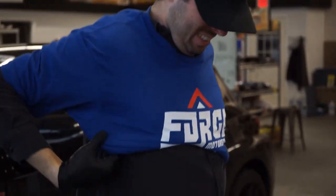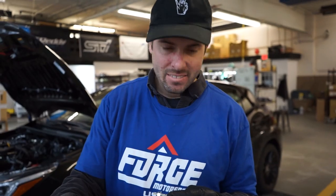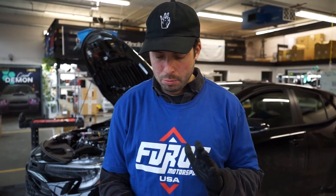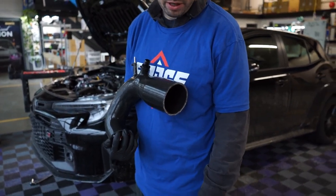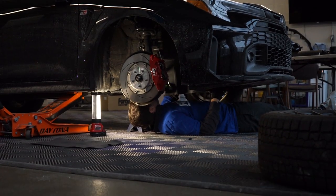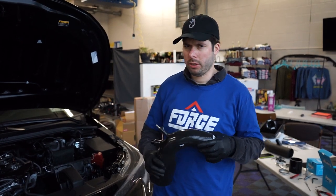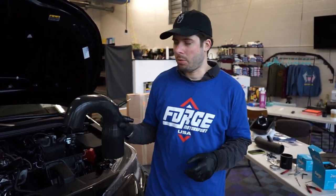We are back. I slept in the shirt, it is very comfortable. I got the turbo stud out - the stud for the inducer side of the turbo. Got the tool for that last night, came out like a dream. We did pick up the correct hardware - I did have to shave the ends down a little bit just to make sure we didn't poke into the turbo. To recap: we are going to put this on the turbo inducer, that is going to go to our silicone inlet opening, this will come up to this hard pipe which mounts to the engine, and then we have our breather tube and vacuum line to plumb in there. After that we are going to put the intake on and see what this bad boy sounds like. She is on there - we have the new machined part on the turbo inducer inlet. We are going to go ahead and put the silicone tube on now. I already put the two barbs on for the vacuum and breather lines just to make it easier since it's not so tight back there when putting it on.